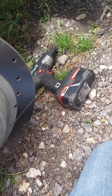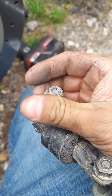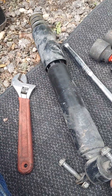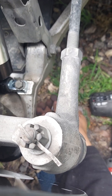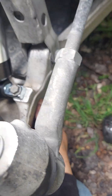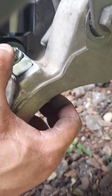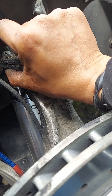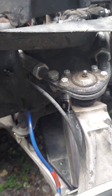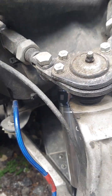That's super easy on the C4. Put the bolt in at the bottom — it barely reaches because the mounting point is about half an inch thick, so you need a 13 millimeter right there. The other end is much thinner so you have fewer threads. When I put in the SPC upper control arm, I had to get new bolts because of the thickness difference, but fortunately this bolt is long enough to get some threads. That's how you mount it — just bolt it up, make sure it's tight.